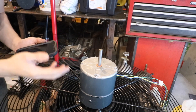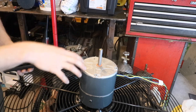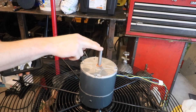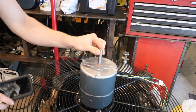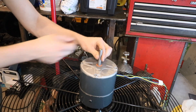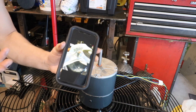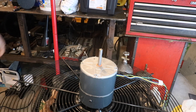Here's a quick tip before you take something apart when you're not 100% sure how it goes back together: before I disassembled this, I took pictures of the unit. One question I had was how high the fan sits on the motor output shaft — and it actually sits flush with the top of the shaft. Also important to note: one side of the output shaft is flat-ground, and that is where the set screw locks onto so the fan doesn't slip when the motor spins. Having a smartphone to take pictures before disassembly can save you a lot of headache when reassembling.